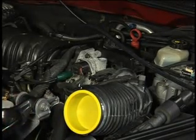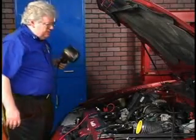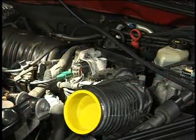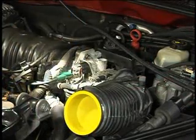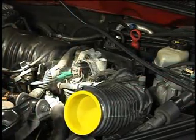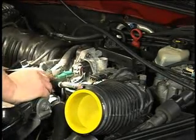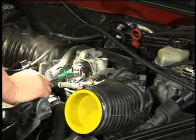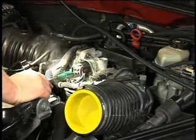Let's get our light ready too. Give it a few seconds or maybe even a couple of minutes. We see some smoke right now — right off the bat, I'm seeing smoke come out. And no wonder: somebody has done a little bit of jury rigging of this vacuum hose connection at the side of the throttle body.